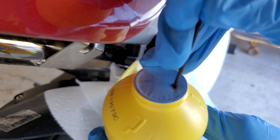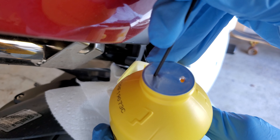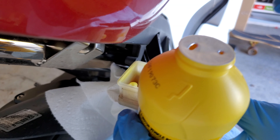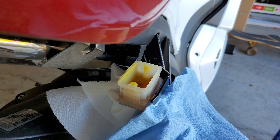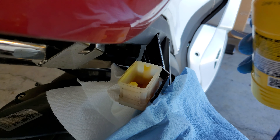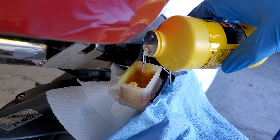Alright y'all, I'm about to start this thing off in the back. We're going to start with the rear brake and the rear brake reservoir. This is when you need your angled screwdriver if you have this model of bike — it helps you get them screws out. As I start removing the cap and bladder, I like to clean up some of the debris that's already there. I do this on the cap and then also on the reservoir itself.